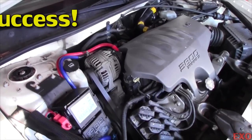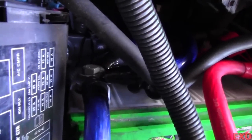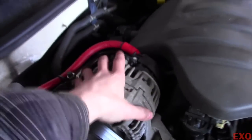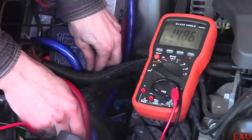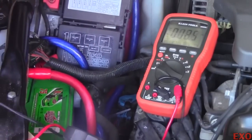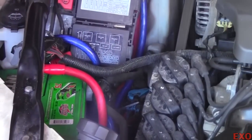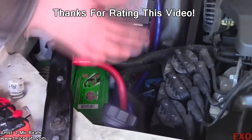Big three upgrade is now complete. Everything's all tucked away looking nice. We got the positive post on the alternator coming down, tucked away, fused right there with a 300 amp, and then the positive terminal all nice and secure. We got the grounds right there — one ground going straight to the frame, one ground going to the alternator bracket right here which grounds through the engine. Let's go ahead and test the voltage real quick: 14.86 volts. Can't ask for anything better than that for a stock alternator. This is EXO signing out, just doing the big three upgrade. I hope that could have helped you guys. I'll see you in the next video when we install the NVX amp kit.